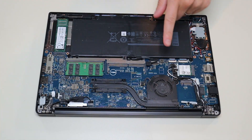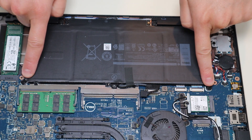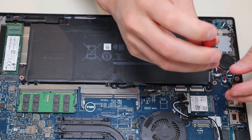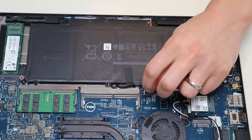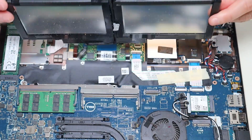And this is what you're looking at for the inside of your computer. Before I touch anything inside the computer guys, the first thing I always do is remove or at least unplug the battery — it makes it safer to proceed. This battery has two screws in the corner and it's plugged into the motherboard. The battery plug has a simple pull tab that you would just grab and pull up to unplug the battery, and then the battery releases.